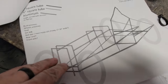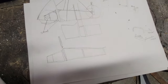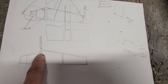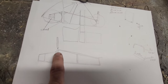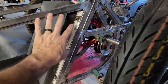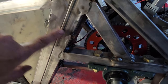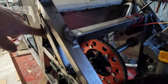I didn't end up doing it exactly as it looks in the drawings. Here are the last drawings I did before I went and built it. I figured out how to make this back section with two pieces that I can bolt together, plus the top piece. I've got aluminum slugs in there of thick square stock. This piece is completely separate from this piece — it bolts together with grade 8 bolts and sleeves all the way through so you don't crush the tubes. There are a total of six of these — two on each side, and then two down at the bottom.